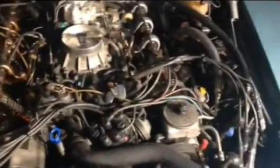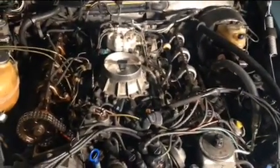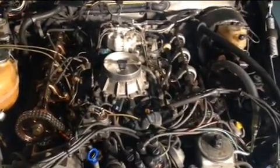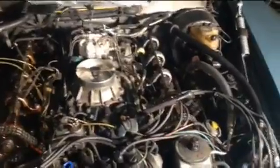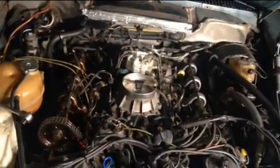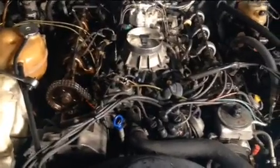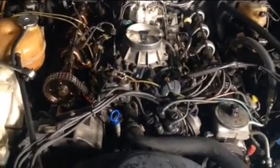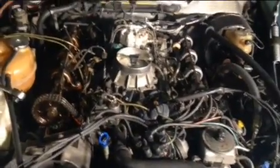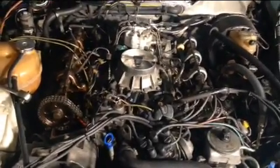So the next step is taking the spark plugs out, inspecting them, and getting a new set of 8 spark plugs. Luckily here it's only 1 spark plug per cylinder, not like the new ones that have 2 sparks for every cylinder. I'm going to do the compression test and we'll take it from there. So in the next video, you're probably going to see me in the next step where I'm checking the compression. So stay tuned, follow the next video, see what happens.